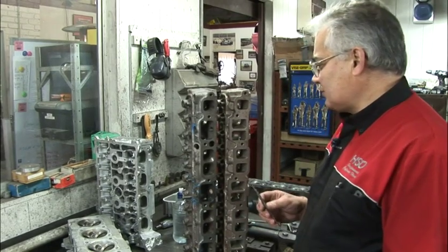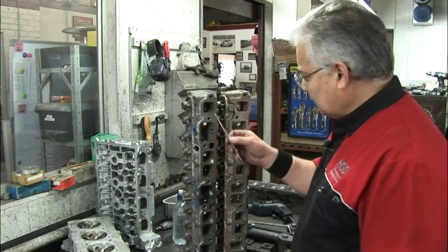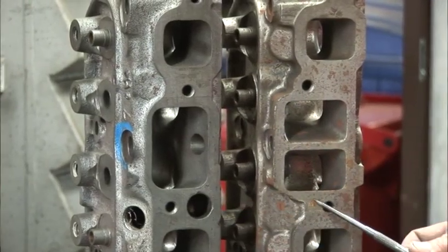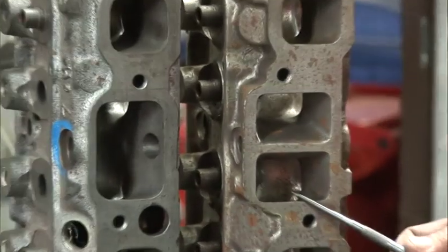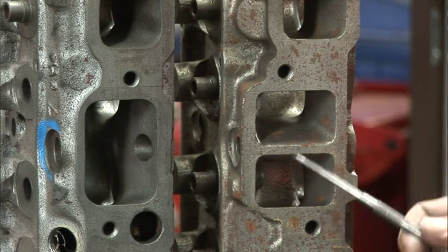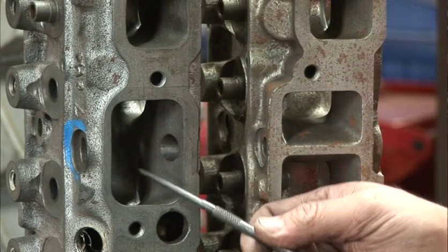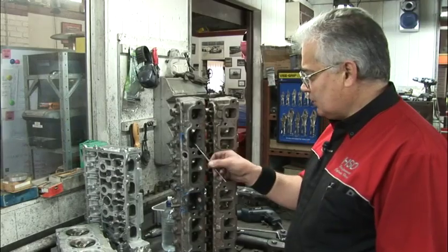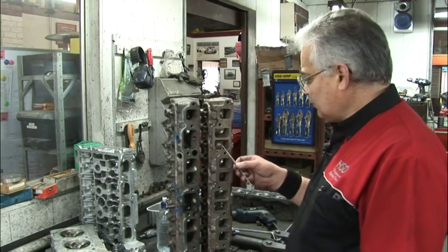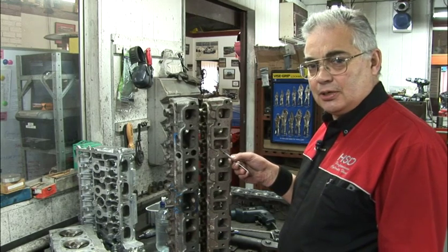Okay, we often get asked the difference between a 9-port and a 12-port 6-cylinder Holden head. If you look at the port configuration here, you can see a Siamese intake port, whereas on the blue motor head, we have individual intake ports. Whilst this produces a lot of low down torque, that configuration will produce more mid-range and top-end horsepower. That particular cylinder head will be producing around 320 horsepower, whereas a fully modified blue motor head would probably produce around 280 horsepower.